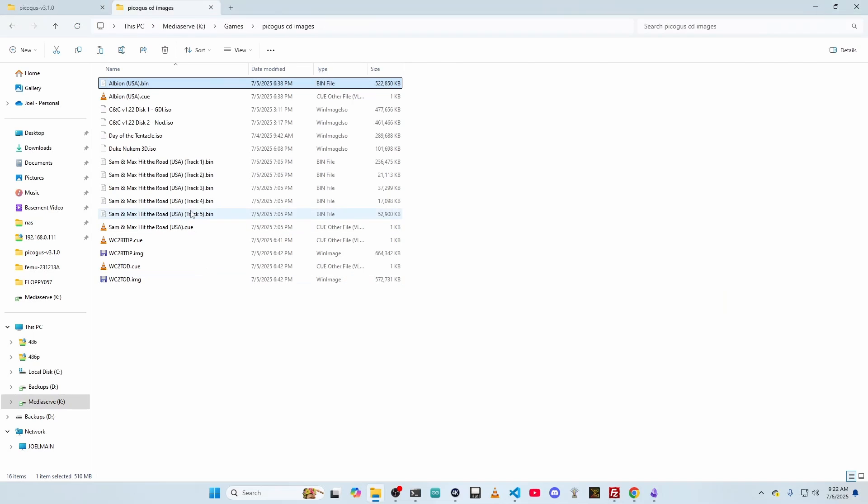The other thing would be just the CD images themselves. You copy both bin/cue or ISO format files onto a freshly formatted USB flash drive. I'm using a four-gig drive, enough to fit half a dozen CD images. You can see here the bin/cue, ISO, and also this Warcraft .img format seem to work fine — I assume the image format is similar to bin, maybe even the same thing with a different name, but those work fine in my testing. These are just the exact directory of files that I copied onto the root of the USB flash drive.